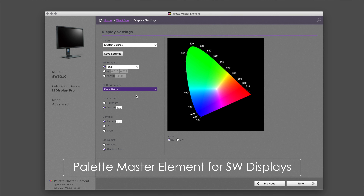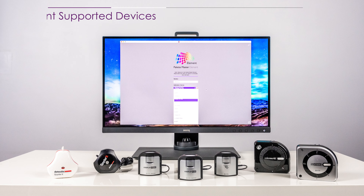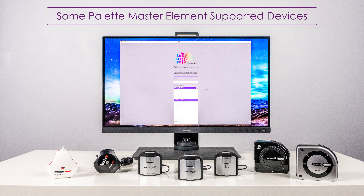To calibrate this display, you would use BenQ software. For the SW, you would use Palette Master Element. The benefit is that it can do a hardware calibration really fast, and it has support for a variety of devices from both X-Rite and Datacolor — so any X-Rite device will work and any Spider device will work. However, Palette Master Element is also known to be feature-light right now, meaning there are certain settings you can't go in and set, and there are some bugs in the software. BenQ is genuinely working through and trying to fix those bugs as fast as possible, and they're also looking forward to adding more features in the future.